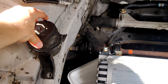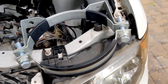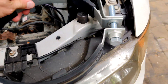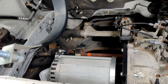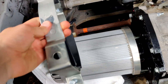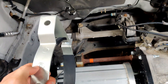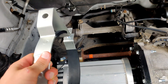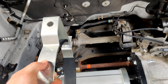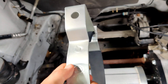It should be able to bear the weight, which is fine. I also forgot to mention that this clamp mounting bracket for the motor will be mounted to the bottom of the battery box. This goes around the motor and has two bolt holes for mounting. It's going to go on the underside of the battery box, and I'll have a reinforcing beam — one of those channels I'll show you in a second — as the mounting point for those two holes.